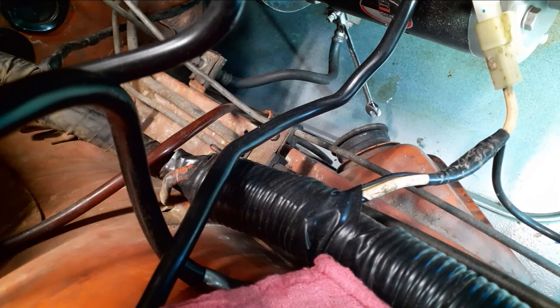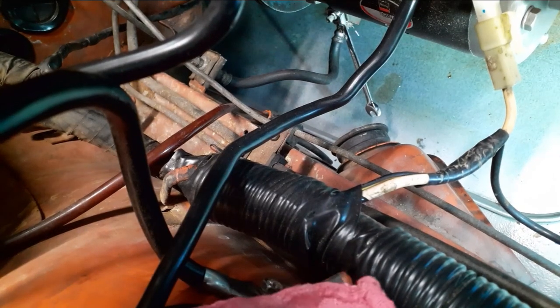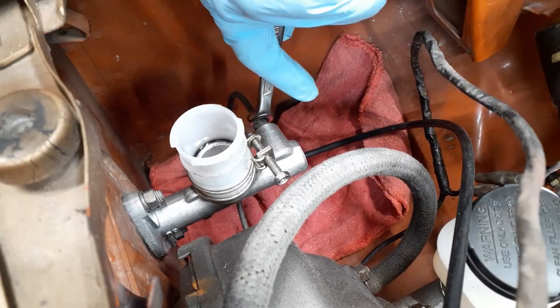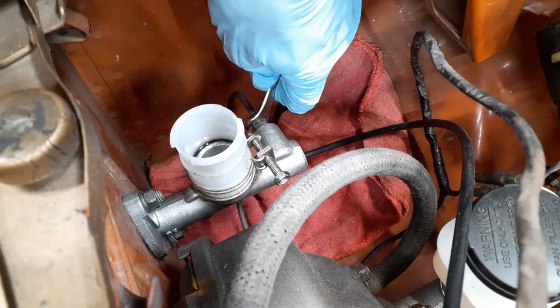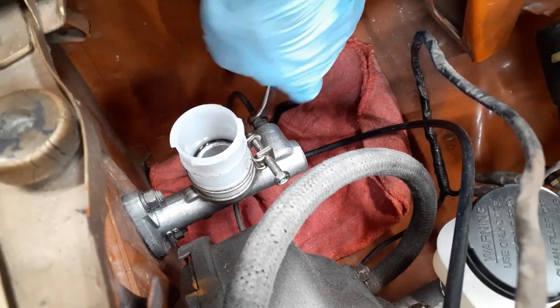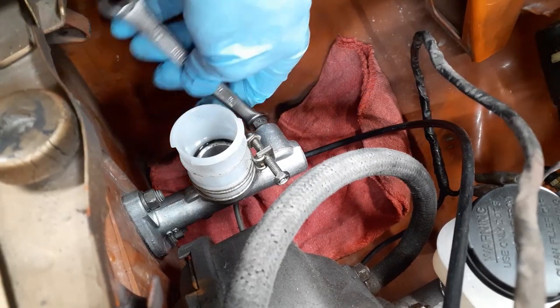I'm going to go over and loosen the hydraulic line on the master cylinder, let it all drain out, and you'll see a little bit more dripping down in it a little bit. Well, not going to actually take you with me. Okay, now I'm going to get the hydraulic line up top loose. I'll let the rest of the fluid go out through the bleed screw. And look at, there we go. Gotta just get it loose here. Not quite finger tight yet.